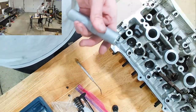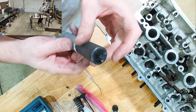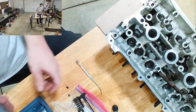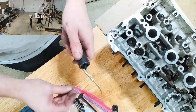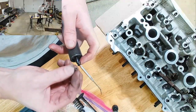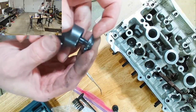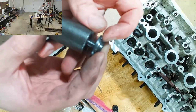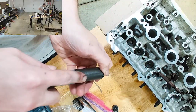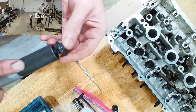The other half of the tool fits inside this, so you still push it in. This little piece right here is spring-loaded. What this does is you mount the retainers like this so they're captive, and then as you press it, it compresses and they're tensioned. When you push this onto the head, it will cause everything to push down evenly and snap the retainers into place.